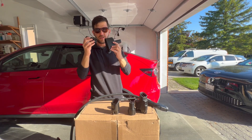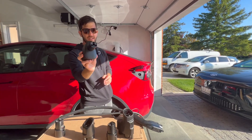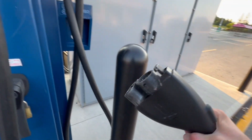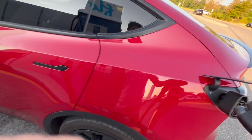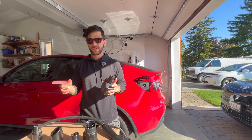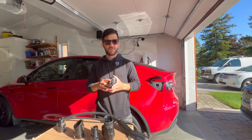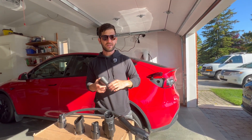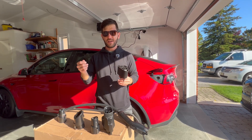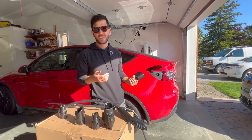So you have both of these in your car and you can pretty much charge anywhere. To use one of these, you basically stick the NACS port here and then you can connect a CCS charging station here. One thing I should note is that not all Tesla cars are compatible. Pretty much any car made after 2021-2022 is going to be CCS capable, and you can check in the screen under additional vehicle information. If your specific car is CCS capable, then you can go to an Electrify America station, just plug in and charge. You will just have to do the activation through your app — it's not going to be as seamless as at a Supercharger where you just plug in and get billed.